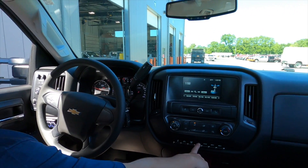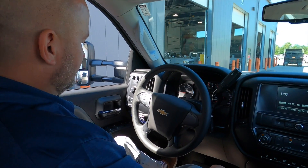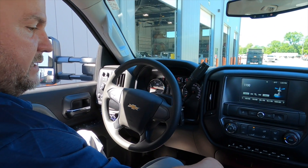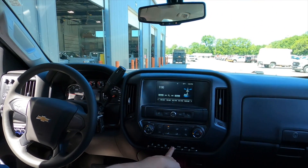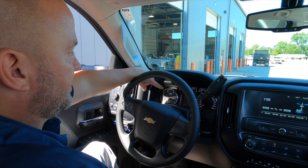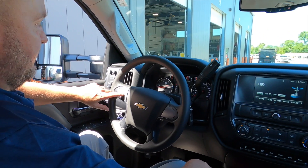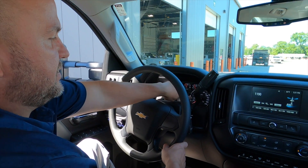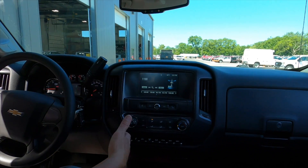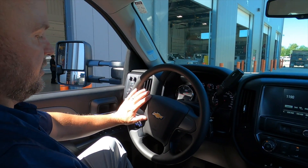To disengage, reverse. A couple of things that might give you a problem: if you jump in the truck, get to the job site, put it in park, and forget to step on your parking brake and try to engage the PTO, you're going to get a warning — it tells you to set the park brake. That's a nice interlock. Also, if you were driving in cruise control and your cruise is still on, it will not engage the PTO. The truck thinks it's in drive mode and will say to disengage cruise. So make sure your cruise is off.